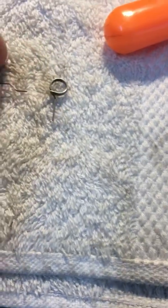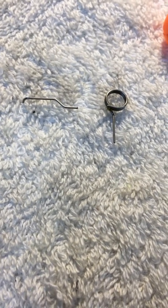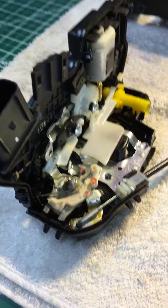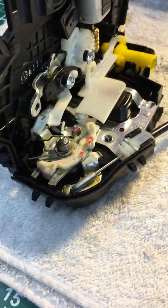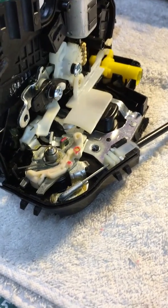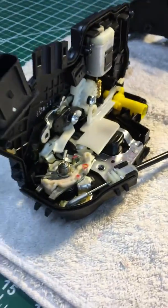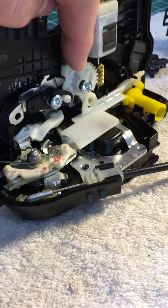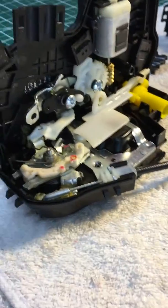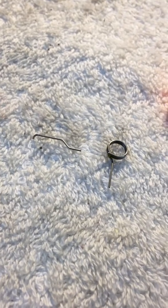Here it is - that spring fractures. That spring probably costs about one cent when you're making a hundred thousand units a year. That has caused all the problems that everybody's having with at least the 2011 Sorentos - I think it might even go past that year since the design likely hasn't changed. That's what's causing the inoperability to open the door through the outside door handle. Unfortunately I've already ordered a $55 replacement assembly, which is relatively complex - you've got a lock motor, lock tooth gear - it's a pretty neat assembly with 11 moving parts. Amazing that it's only $55.